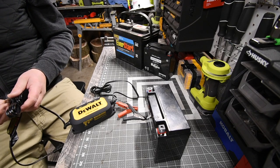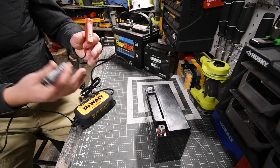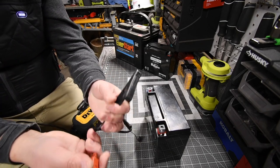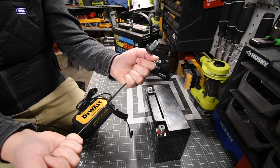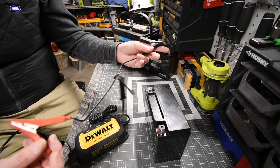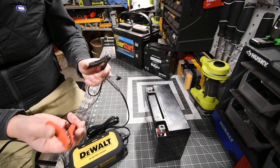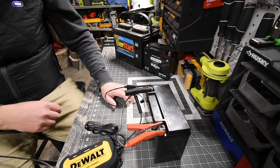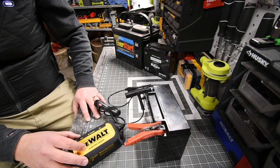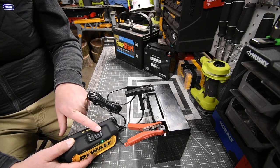I might need to replace my big battery for the boat because I bought that in 2016 — it might be time to change out that core. This is how you prevent batteries from being ruined. I will say right off the bat, you are going to have to separate the cables a bit, which it's designed for, but people get nervous to do it. Leave about an inch connected so the cable doesn't get too damaged. So let's connect negative, then positive. I noticed it was on 6-volt and it didn't operate, so I switched it back to 12-volt and then it turned on.